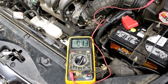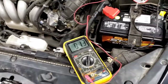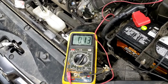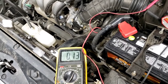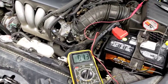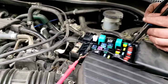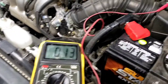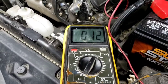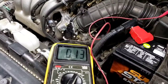We're back — it's been 20 to 30 minutes and we're still at 130 milliamps, 0.13 of an amp. So now we have to start pulling fuses one at a time until we see the draw go down. Pulling them now — no change, next one — no change, about 10 milliamps difference which is nothing, next one — no change.